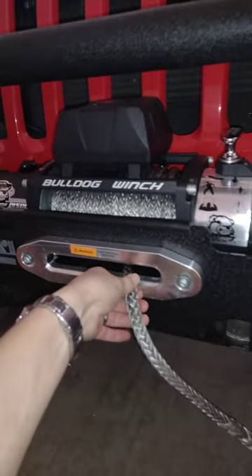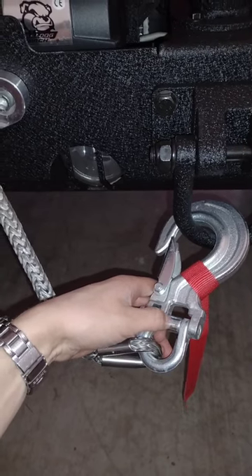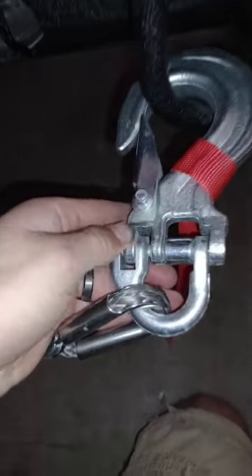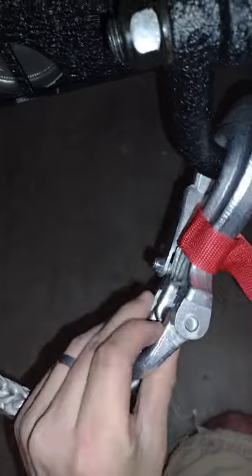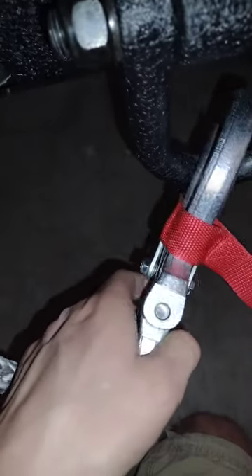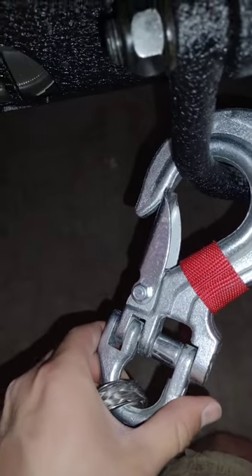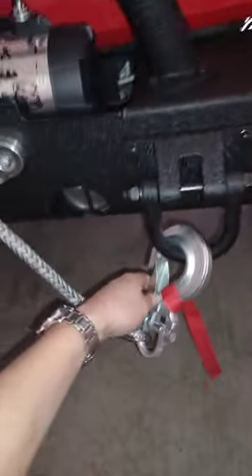Your final step is to pull the synthetic rope out through the front side of your bumper. It'll stop right here and you'll have this massive hook, a D-ring, a spacer where my thumb is right here, and a small metal dowel, and this red ribbon. To put these together, you put the D-ring like this with the spacer, hold those together while you fish the metal dowel through. It won't go smoothly through this metal spacer — you actually have to hold it together and with a hammer pound this metal dowel through. It will then sit snugly but have a little bit of play in it — that is how you connect those together.